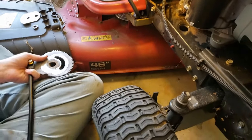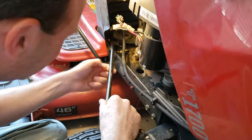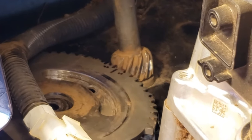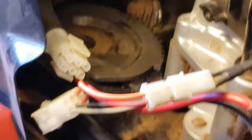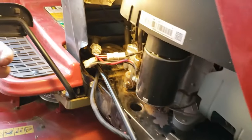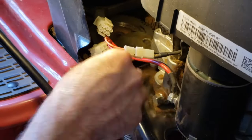Got to have the steering wheel straight and make sure your wheels are straight — then you'll know everything's good to go. I've got the steering wheel straight and you can see that black line there on the gear plate, and that is right in the center of the groove of the gear on the steering column. I've also attached it here to the wheel with the wheel straight, so that's going to keep it in line. Next thing, take this little round spacer that was in there — that needs to go in the metal plate right in the middle, that big hole. We're going to put that plate back on.